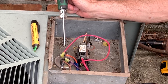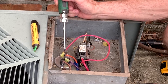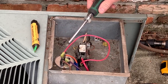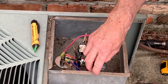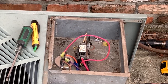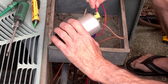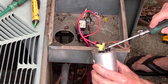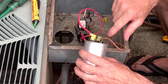The remaining item that could still be charged in this unit would be this capacitor right here. Before you touch these leads, what you want to do is short these leads out across each other. You want to use an insulated screwdriver — don't touch the metal — and just short these leads out from one to another. Now I'm going to do it again when I get the capacitor out. Now that I have the capacitor out, let me take my screwdriver again and short these terminals to each other to discharge it. Now this capacitor should be safe to touch.